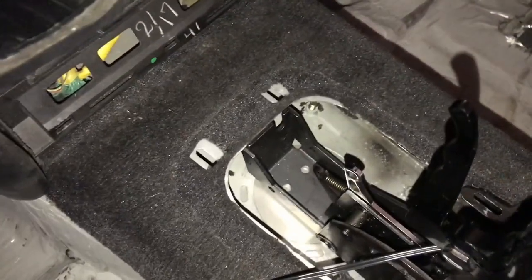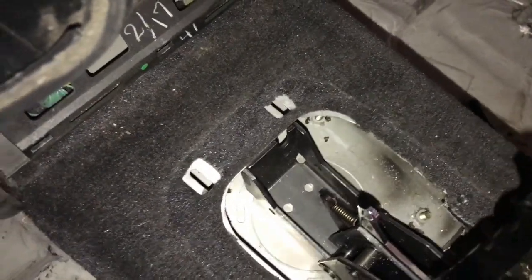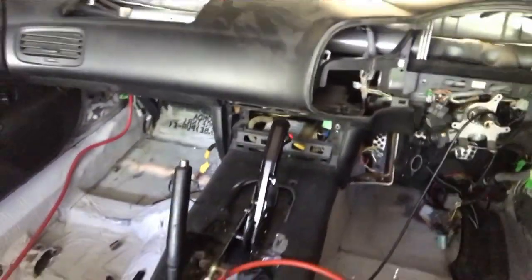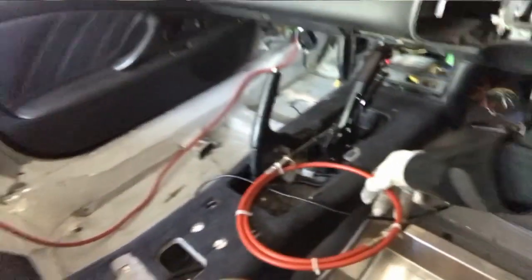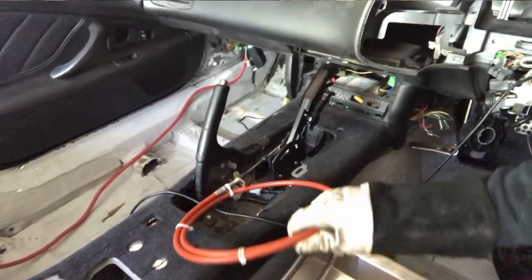So now you see those bolt holes that are straight down through there. I can add some bolts and washers - probably not tap that though, just because it's 16 gauge, it's not super strong. I've kind of just been working along this morning - put the camera down after I was putting the shifter in and just kept moving. Anyway, shifter is in and mounted, just got some screws going down through those three holes up front like I showed you. The cable is not quite done yet - just reading up on it a little bit, exactly how to do it. I know it's not too complicated, but I've never done one before, so I want to make sure I got it right.